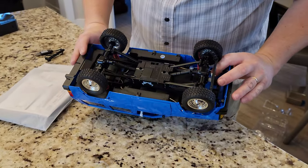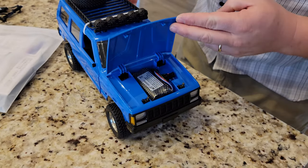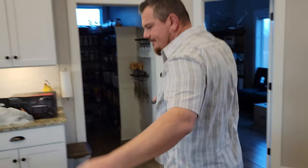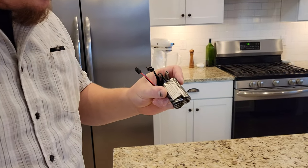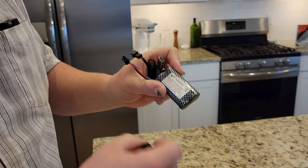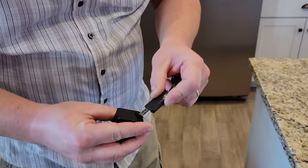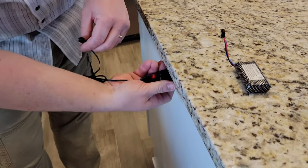There's a power switch down here — on or off. Let's open the hood. It looks like a NiCad battery, but nope — it's a lithium ion, 7.4V. So let's go ahead and charge it first. This is a model 18650, which is a 1200 milliamp, 8.8 watt-hour, 7.4 volt lithium ion battery. We have to provide our own wall USB adapter. We'll plug that in — there's a red and green flashing light. This is a keyed plug, it is proprietary.